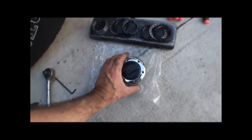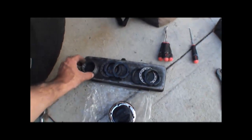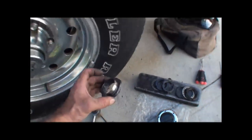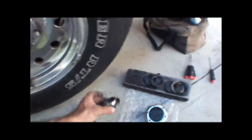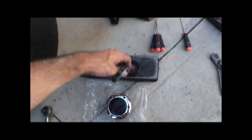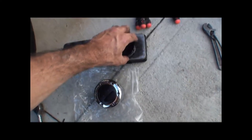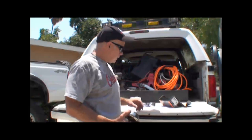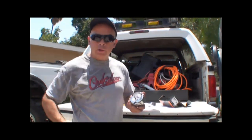This is what he got — he's got the Mile Marker hubs, and he's got the conversion kit. Because you need to take this bearing adjuster nut off and replace it with this new bearing adjuster nut, this little ring that locks it in place, and then a locking nut on top of it. Here's a quick breakdown of what we did besides packing the wheel bearings.